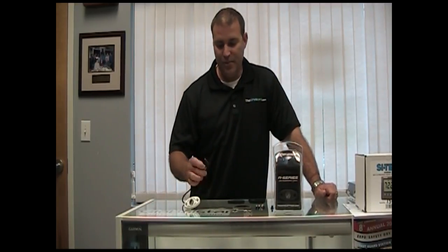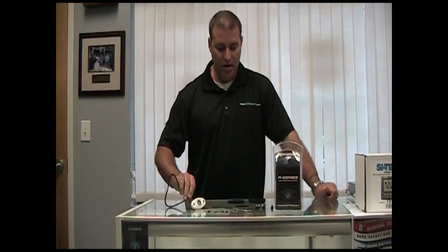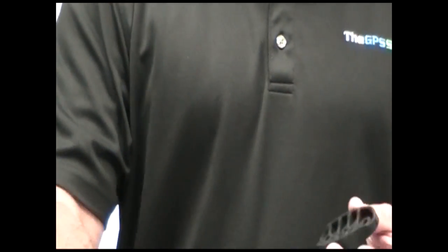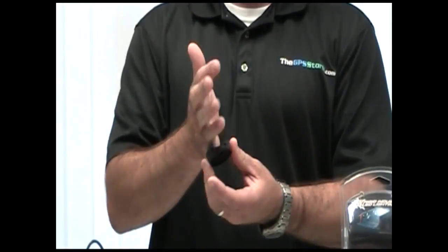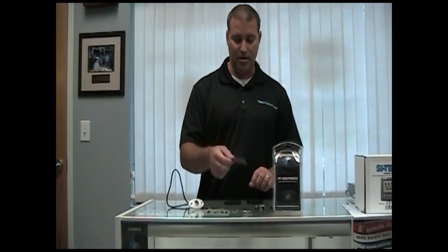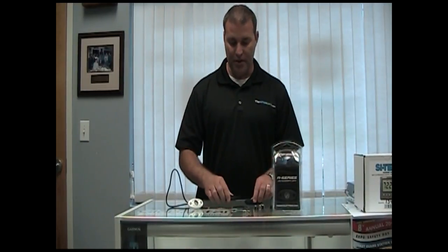When you open up these lights, it's as simple as connecting them to power and ground. I would recommend running it to some kind of switch so they're obviously not always on. You're going to get two different types of flush mounts — one designed to mount to a flat surface, and one that's pitted so you can mount it to some kind of bracket. It also comes with all the screws and hardware you need and a two-sided sticker so you can mount it to a flat surface, though I'm not sure how well that will hold up underwater.